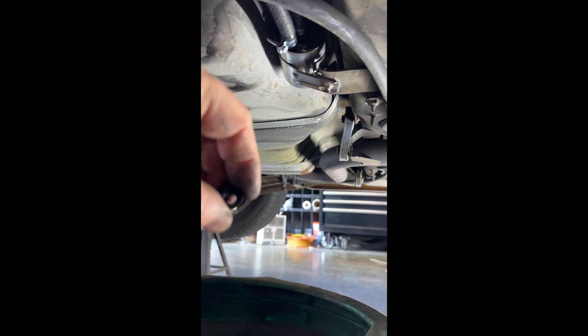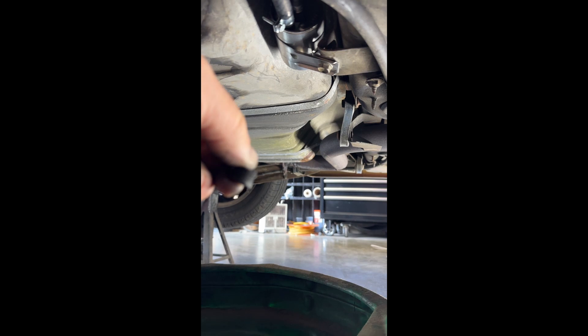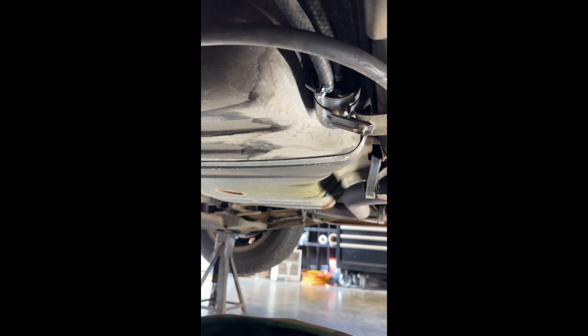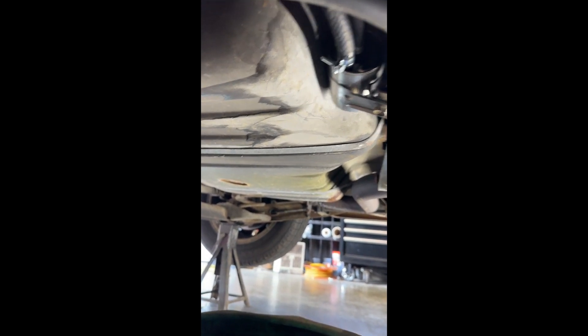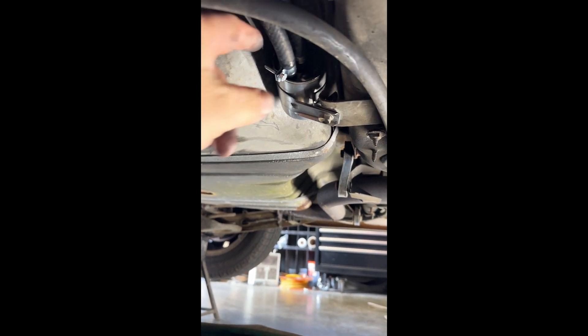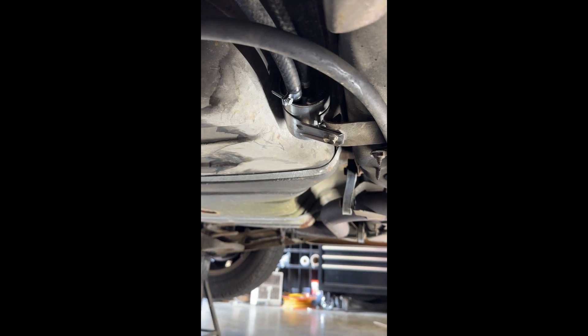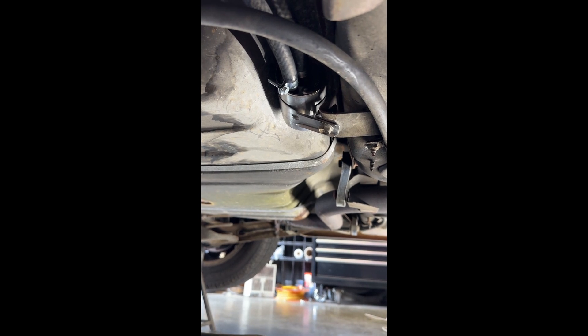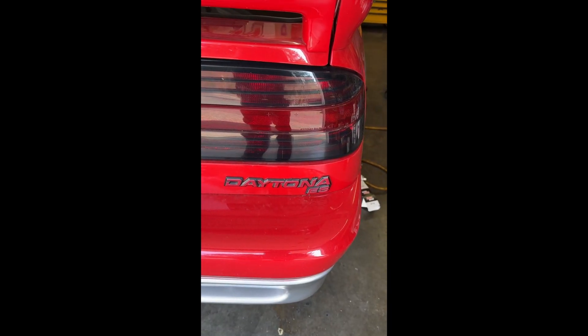The hose over time had collapsed a little bit on the inside, so I trimmed just under a quarter inch off it, which left me enough room. If I had to trim any more and it still wasn't getting a good seal, I'd actually have to replace the hose. I trimmed the hose back a tiny bit, reclamped it, cycled the key a couple more times, double-checked it — it's nice and tight, not leaking at all. Glad I checked that.